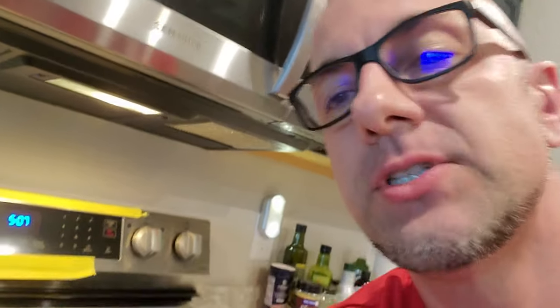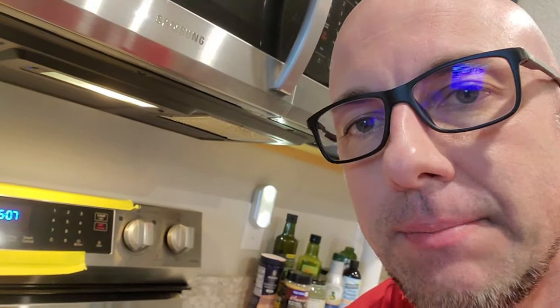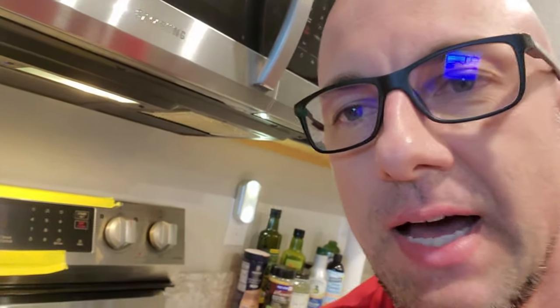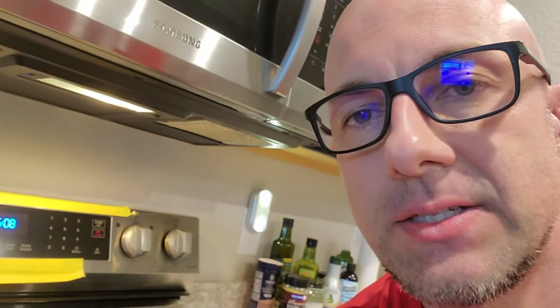The first feature is the temperature adjustment. If you feel like your oven is cooking too hot — burning things — you could lower the temperature internally so that when you set it to 425, it might actually be cooking at 415. Or if the calibration is off, you could correct it. An oven thermometer would help with this. The oven is calibrated by Samsung. The second hidden setting is the temperature unit — either Fahrenheit or Celsius.